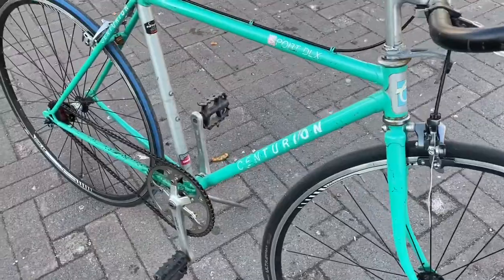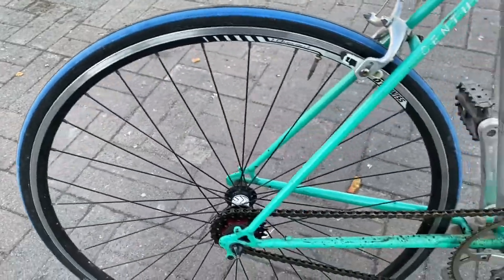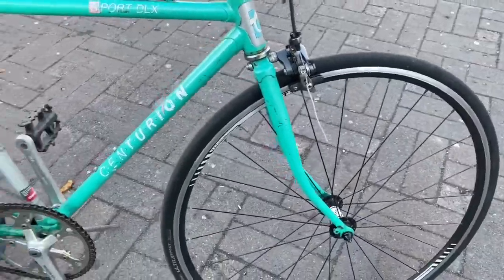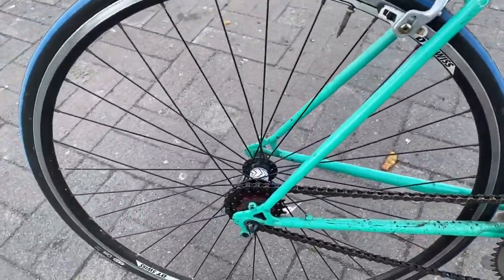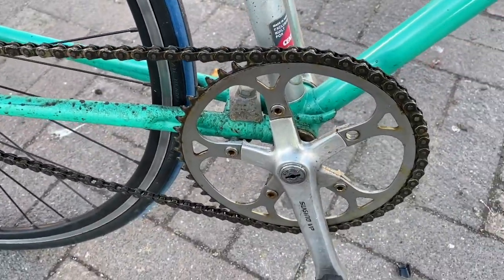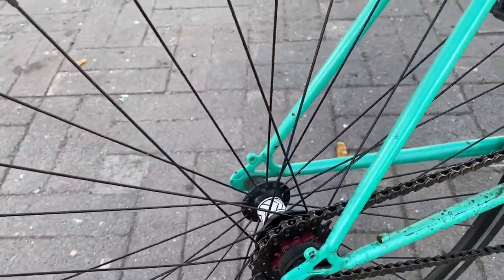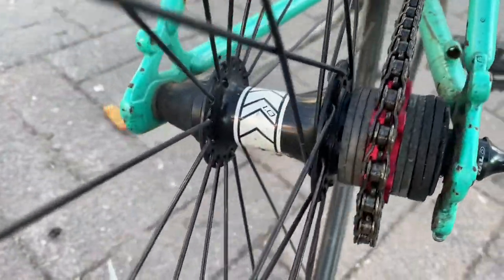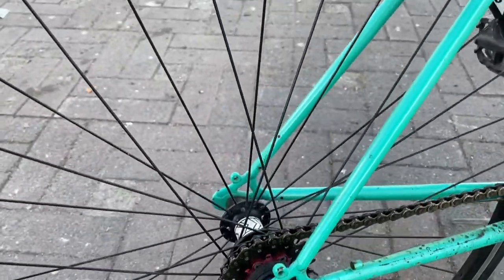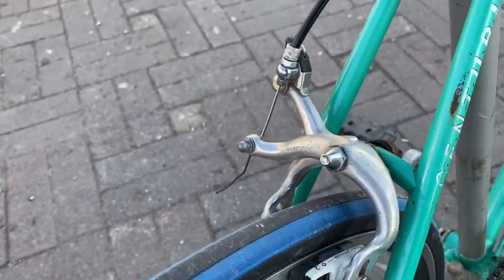One of the first things I did was get these wheels. They're DT Swiss, pretty high-end wheels. I got them on Craigslist, and that was pretty solid. From there, I gutted the shifter system, and I removed the two back gears off of this main crank. Then I removed the derailleur, and I added this really nice machined anodized conversion for the freewheel.